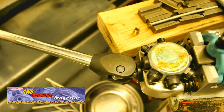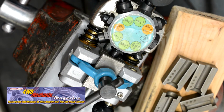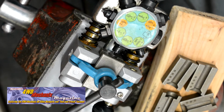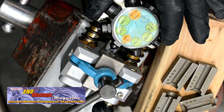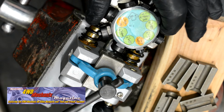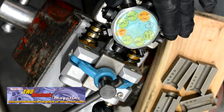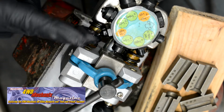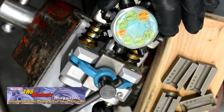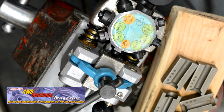Rotate the manual hand lever smoothly with uniform force until there is distinct resistance. Then release the turret from the die and rotate the turret to the second operation, which is the 45-degree cone that will press the convex half of the flare into the inverted seat to produce the double 45-degree inverted flare.